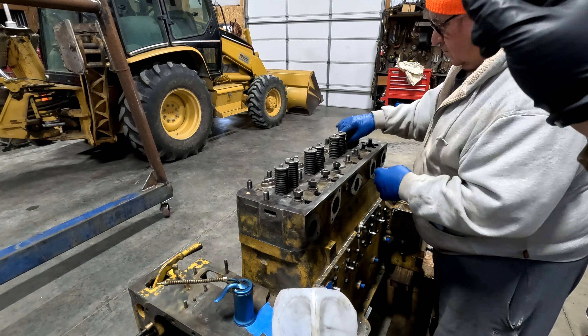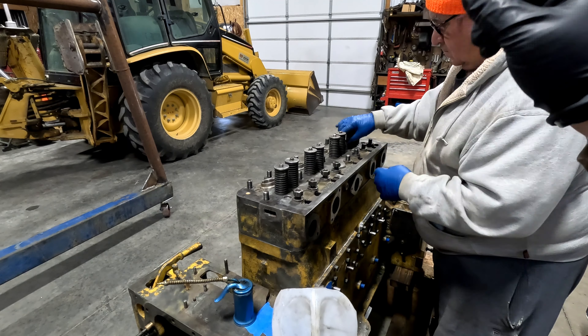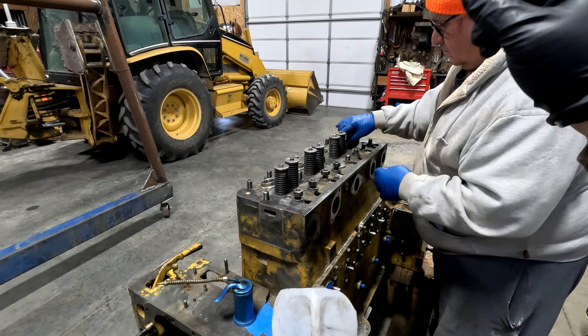Dad's putting the nuts on. We put one drop of oil on each one of those, and there's a washer underneath. The nuts are directional - there's a machined flat surface on the bottom that goes up against the washer, and the more rounded area goes towards the top. I'm going to get the speed wrench out and snug all of these down. Once they're snugged down, I'll use the standard torque sequence for an engine cylinder head - in the middle outward - and we'll do all of them to 90 foot-pounds. Then I'll up it to 130 and go over the same sequence again.